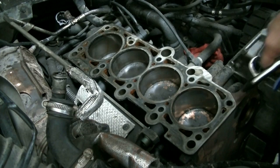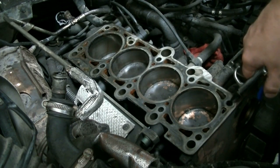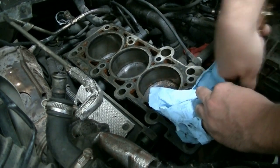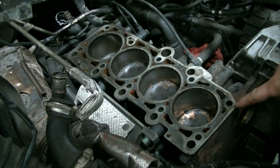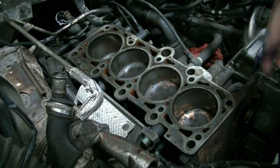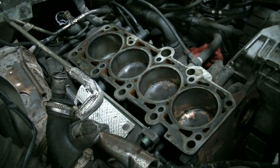You also want to make sure you clean the inside of these bolt holes for your cylinder head bolts. Get some compressed air, put it in there with a rag around it, and thoroughly clean it. Make sure you get any coolant or any other dirt or debris out of there. After you scrape off the top, quickly do this again — get any dirt that dropped in there out as well.